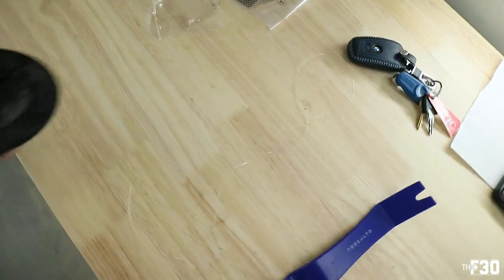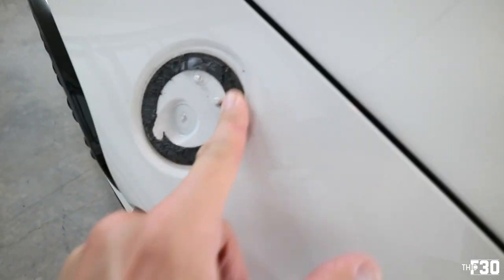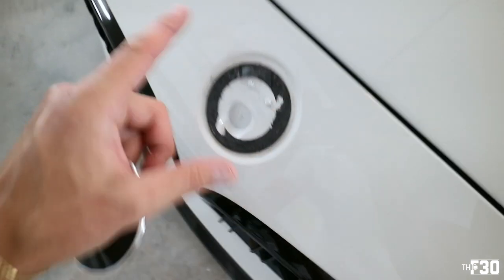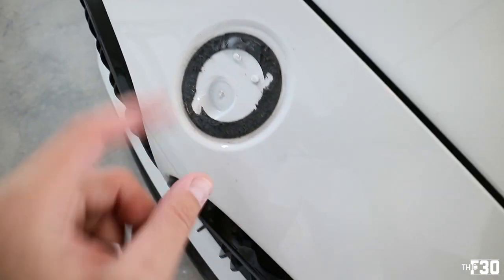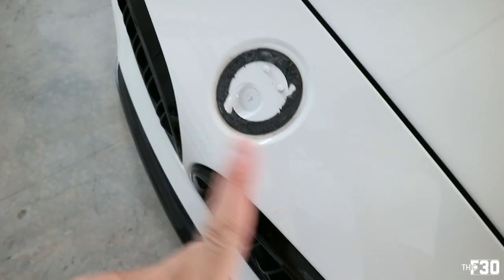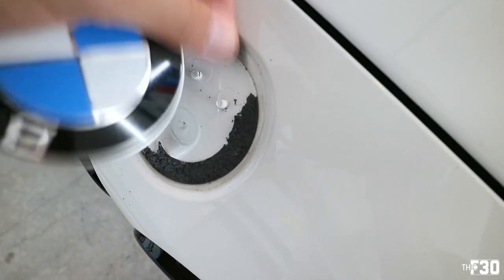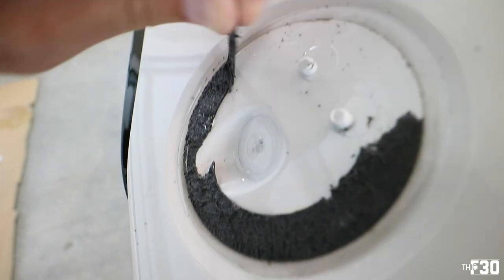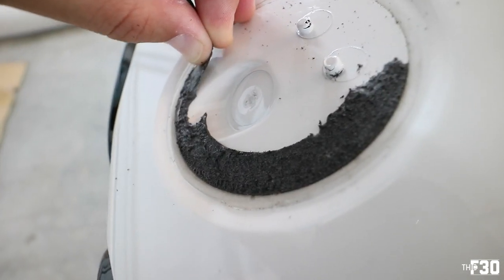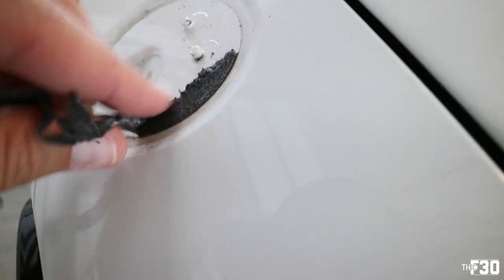I ended up going with the fishing line technique — just took about a foot-long piece of fishing wire and peeled it off. We do have some little residue left over but it'll peel off pretty easily by hand. If you use fishing line, make sure you're pulling up — this whole front end is PPF so I'm not super worried about it, but if you don't have PPF you can really scratch your paint with the fishing wire. Make sure you're lifting up when going back and forth. Little trick: pull away from the adhesive rather than pulling up — that releases the adhesive easier and you don't break it into little pieces. Lewis over at Sensational taught me that — freaking legend.